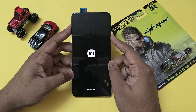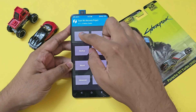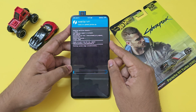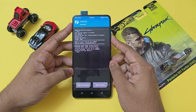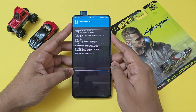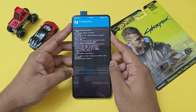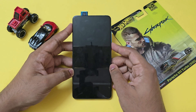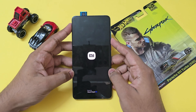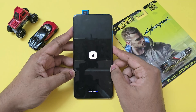Go to Install, select the 10 GB partition script, and swipe to install. This will completely wipe your internal storage and repartition the device. Once done, copy the One UI 6 ROM to your internal storage, go back to Install, select the ROM, and swipe to install. The zip should flash in a couple of minutes. Before rebooting, format data to remove any encryption keys from your previous ROM or MIUI. Then reboot — it may show a Samsung Galaxy boot animation, but if it hangs, hold the power button for 10 seconds to force restart.